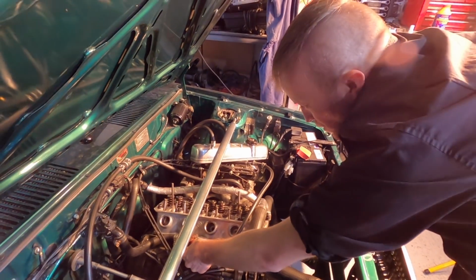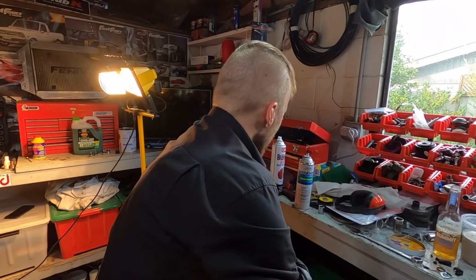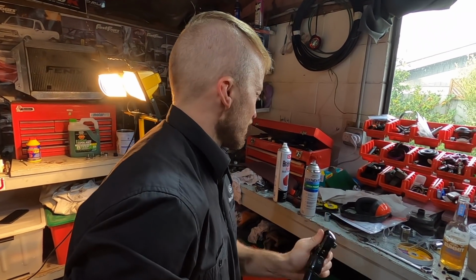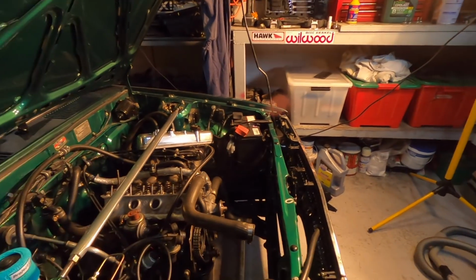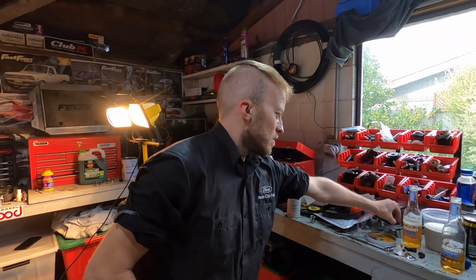Yeah, well, that looks like it's in the right spot. We're doing good. Tighten that cam bolt, because that is the thing that messed me over last time. In case that strips again, we're going to take all this back apart, which it won't, because that heli-coil will be a lot stronger than the original threads.